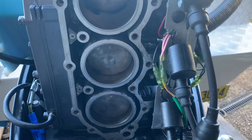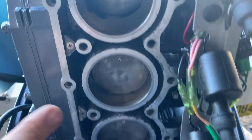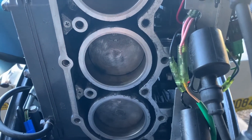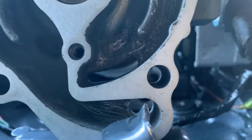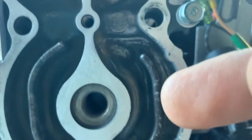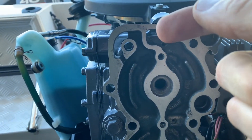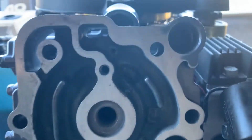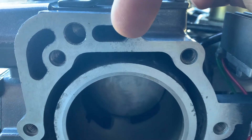I'm going over where the water travels in the outboard motor. It comes in through all the different inlets - there are seven on the 40 and 50 horsepower. They flow in, fill up all around the cylinder, and once it gets to the head, once it fills up all around the cylinder, it comes in through this little port here and fills up the head as well, all the way to the top. Then you've got this port here that goes into the thermostat housing, in through the first thermostat housing hole.